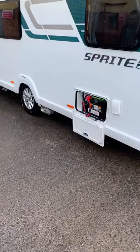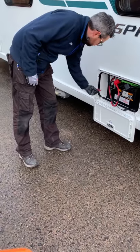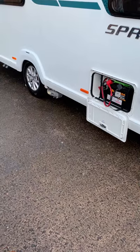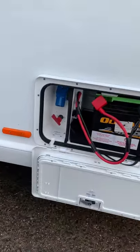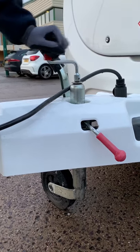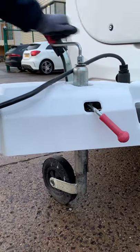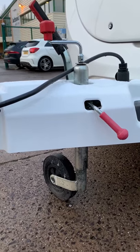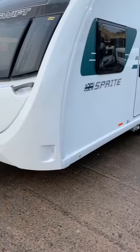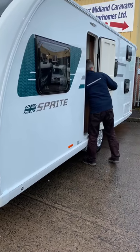At this stage, locate your mover's isolation key and ensure it is turned off. You should be able to remove the key when it is in the off position. Make sure any wheel clamps are removed and that the jockey wheel is sufficiently raised to allow the caravan's nose to turn. A good tip is to ensure that the caravan's internal 12V supply is switched off to allow maximum power to be delivered to your motor mover from your leisure battery.